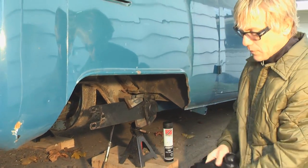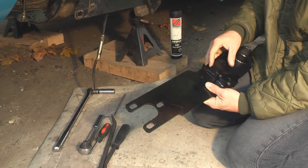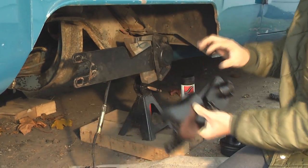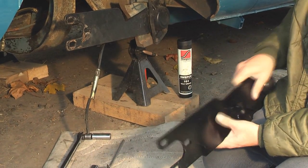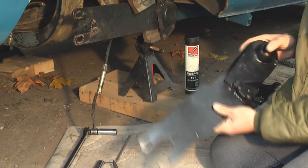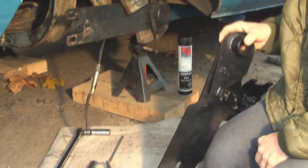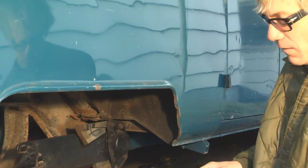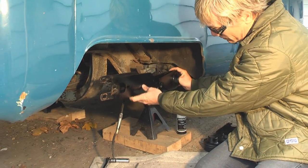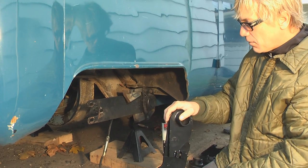What I ended up getting, which is a really cool product from Busboys, is the adjustable spring plate style — basically what I have on my Porsche, the race cars and whatnot. This allows you to set the corner balance on it. When these are on here, you can adjust them finitely, so when you go get it aligned you can really make it precise in the rear end. It's also a lot thicker — obviously a much better piece. One concern is the bus isn't going to ride as low as it used to. I'm going to start off with it in its highest position and optimize whatever clearance I have. If it hits that stopper I might have to redo the whole project, but I'm willing to take that chance.